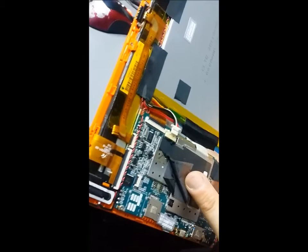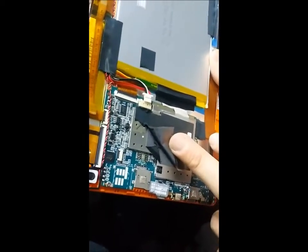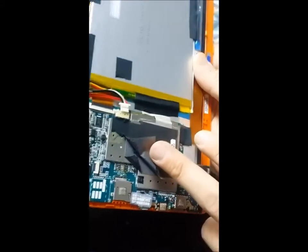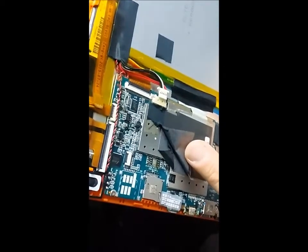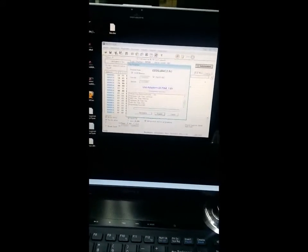So we tried to change the BIOS chip. We desoldered the BIOS chip from the motherboard, and we are programming it right now with the backup file we found on the internet. We will put that file in the description for anyone who may need it.